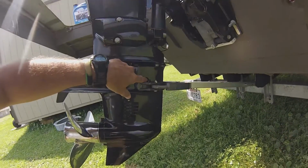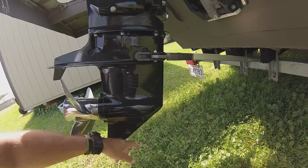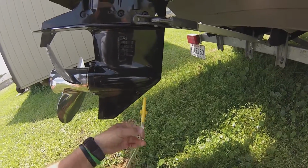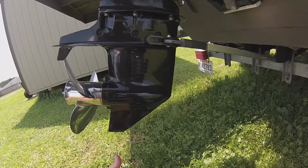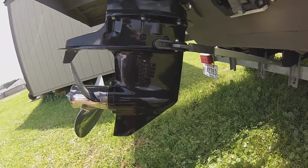Alright, with the new seal, cap it off with the new gasket. Then, this is the tricky part, you have to remove this as fast as you can, and then insert this screw as fast as you can in order to not allow, you know, a lot of oil to come out, because that's pretty much defeating the purpose of saving your gears.